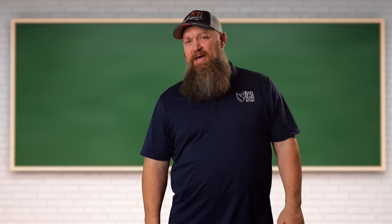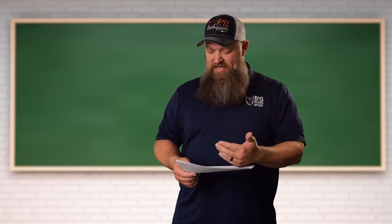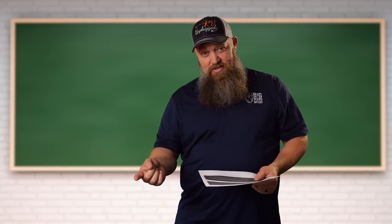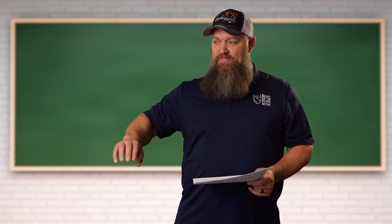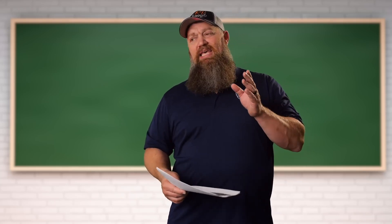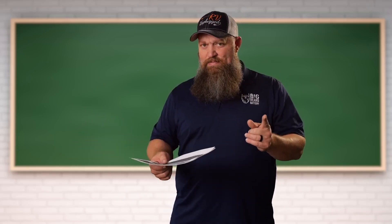You don't need the house batteries — you can take those out. So if it's in storage or something like that and you'd like to have a little bit of power in there, that's fine. But my question is: why aren't the batteries in there in the first place? Are you running the RV now without your coach batteries? There may be a reason — maybe you have to switch them out and it takes some time before you get new ones. This is that in-between time. Can you run your motor coach 12-volt system just by plugging into shore power with the converter? Yes, you can. But the more you use that, the quicker you're going to wear down the converter.